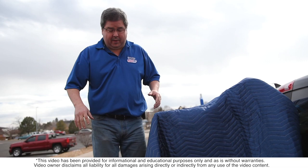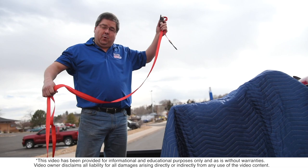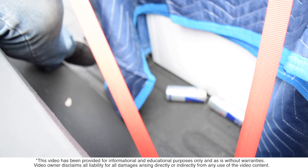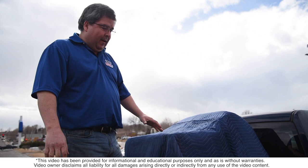The proper way of doing it is you want a minimum of two straps. I'm going to put one on the bottom — get your attachment point and bring it about a third of the way up the unit. Then I'm going to take one more strap across the top, because most vehicles don't have a high enough attachment point to go up and over and then back down.